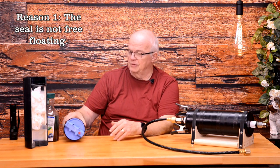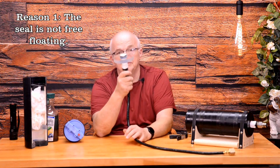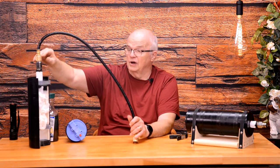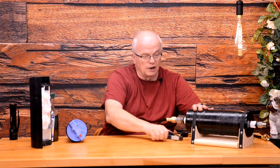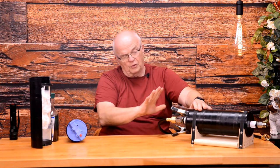What I've done to overcome that: the door to my unit is free-floating. You can see it goes in here and sits up against the O-rings. It's held in there but doesn't lock — all it does is press up against it, so when the vacuum pump turns on, it sucks this cap down against those O-rings and forms a very good seal. I use these clamps simply to hold it up against the O-ring; there's nothing screwing or clamping it on. But when it draws a vacuum, this cap holds a vacuum. I've seen the vacuum get down below 300 millitorr, almost to 200 millitorr — which is really excellent, as good as if you didn't have this unit between your freeze dryer and the pump. That's the first reason.